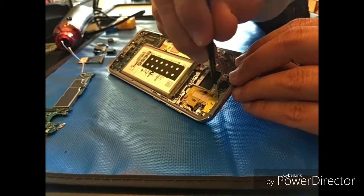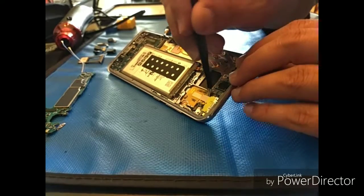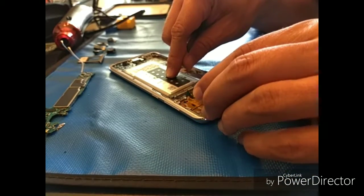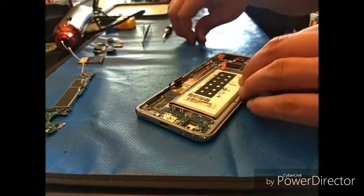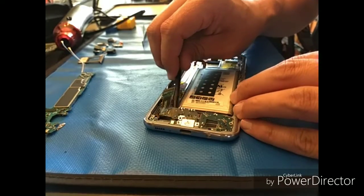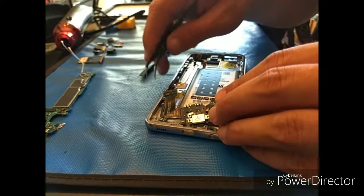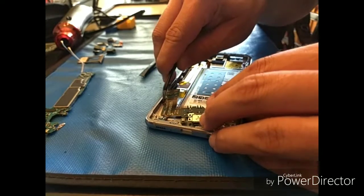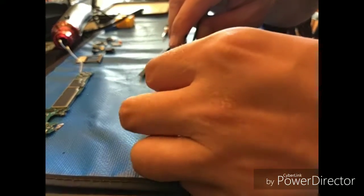And same thing, you could heat it up if you want to, but you don't necessarily have to. And from there, we're going to go down and charge it. Be careful, and you'll see it here in a moment, you don't want to just yank this out because there's a little antenna on the side there and it's underneath a little lip. And there is adhesive on it, so really I do recommend heating this part up. It makes it a lot easier to pull off, but you'll see the little lip once you're a little closer there.